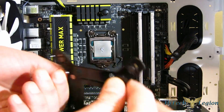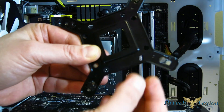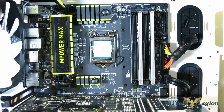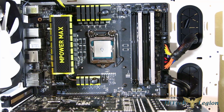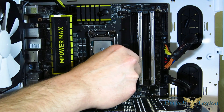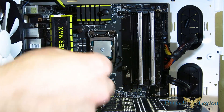Now let's take a look at getting the H5 mounted up. First step: backplate. If you're doing the Intel mount, the bolts on the backplate have three positions — 1366 on the outside, 1150 series in the middle, and 775 all the way inside. They click into place. Just put them in the correct position for what you're mounting and the backplate goes into place with the four bolts coming through. Next, take your standoffs — rubber side threaded to the motherboard — and hand-tighten them until they stop. They do have a stop and do not tighten all the way. Don't worry that the mount is loose; it tightens up when you actually put the cooler in.